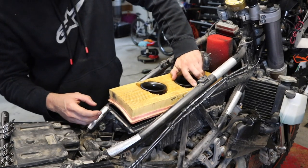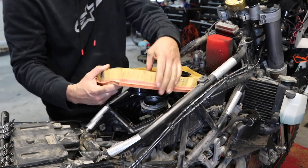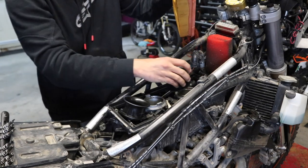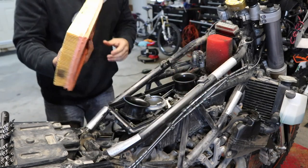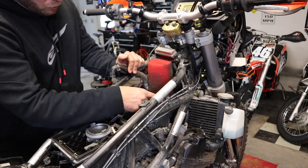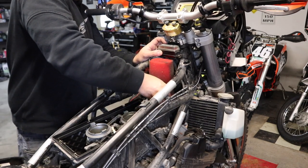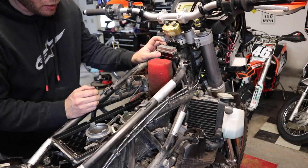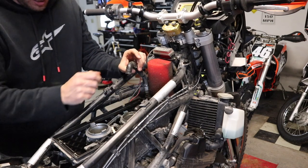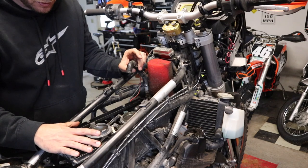We're going to turn these velocity stacks here — they'll kind of lock or unlock out of place, which makes this a little bit easier to pull out. We can just pop these out of the bottom or the top, whichever works. The front of your bike might look a little different to mine because I don't have the factory snorkel — instead I have a uni filter just kind of popped into place. If all you need to do is change your air filter, you can pop in your new air filter, spin your stacks back on, and you're good to go. But if you want to see how to take this thing all the way off, that's what we're going to do next.